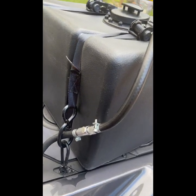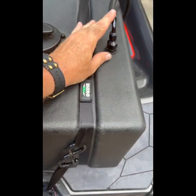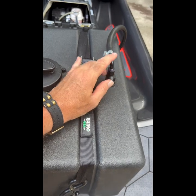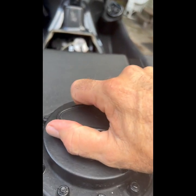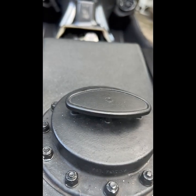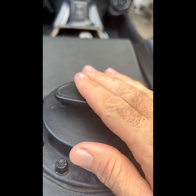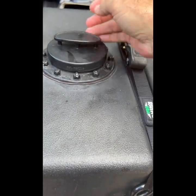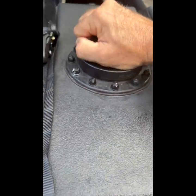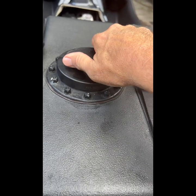What's different about this 16-gallon round track tank is that this side is your vent side, and I have a vent already inside that runs through my P-Trap up front. But on the 18-gallon tank, the gas cap is actually your vent. I'll show you a quick video of a gas tank we set up with the gas cap in just a minute. With this one, I don't have to do it through the gas cap — I have my own line on each side. I don't have to disconnect every time we go to put fuel in; I'm just turning and fueling up. So it makes it a little bit easier when you're out and about.